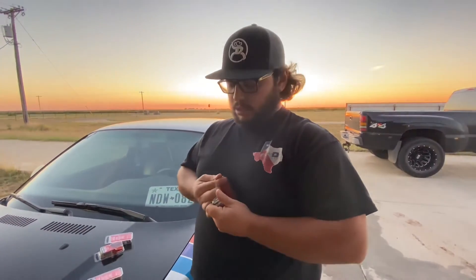My gorgeous wife helped me mock them up. I got the holes drilled — I'll show the video of that, of course. I went with something different this time. Usually I'll just do like a 5/16ths bolt, and that's what I drilled out for, so I drilled them out to 3/8ths. The reason I did that is so I could allow for some room — some room for adjustment — because we know humans aren't perfect.